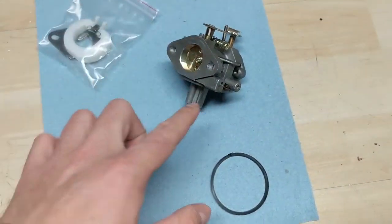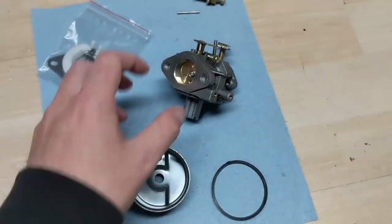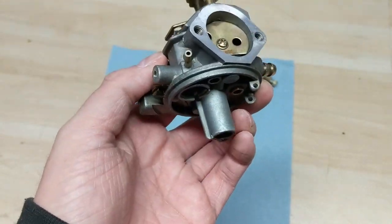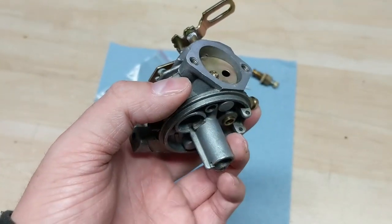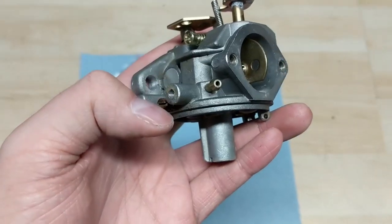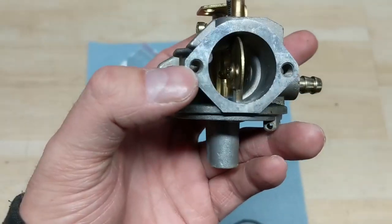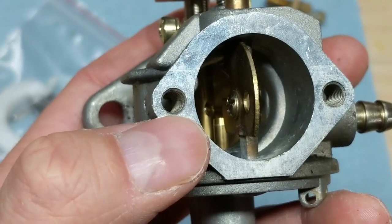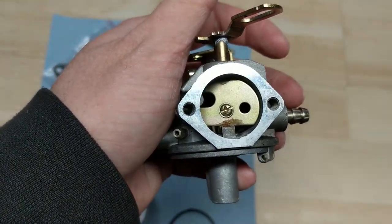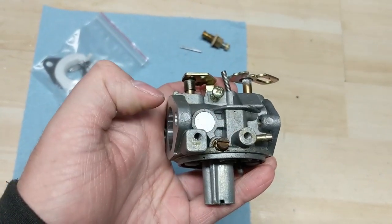You have to imagine that this carburetor is going to have the bowl on it and it's going to be sealed with this gasket, with fuel in the bottom of the bowl — that's sealed. So what happens when you pump air into the bowl, the only place for fuel to go is up the main jet. So when you prime your carburetor, it pressurizes the bowl. That fuel has nowhere to go other than up the main jet, and then it squirts the fuel up the distribution tube. With your choke plate closed, you get less air and more fuel, which creates more suction in the carburetor and gets the fuel into your engine. And then once your engine starts up, you can take your choke off and it will run normally.